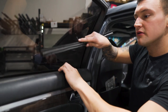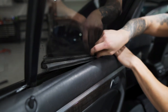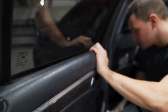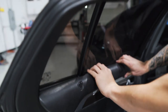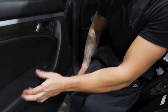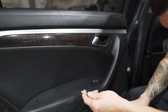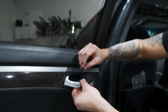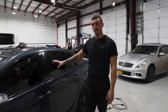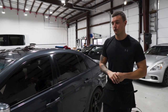Let's move on to the back door — same exact thing. Slide the gasket on, make sure you wipe it off, roll the panel on top of it, push it down in there, make sure the clips are clipped into place, and the same exact three screws. Get the one in the bottom — same thing with the front cover: get the front edge in first, pop it into place. And that is how you tint a 2007 Acura TL — all the side windows and the rear window. Remember: after heating up that quarter glass window to work out any imperfections, let it sit for a while. I'll see you guys in the next video.